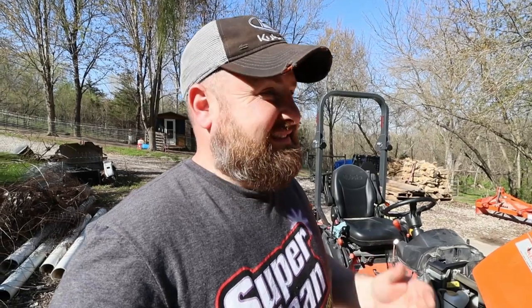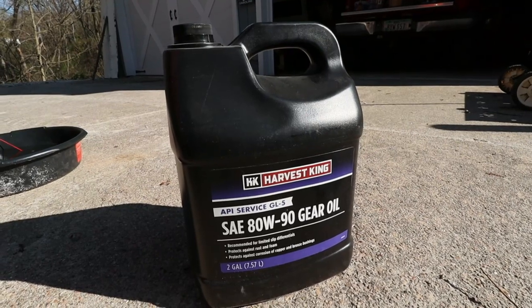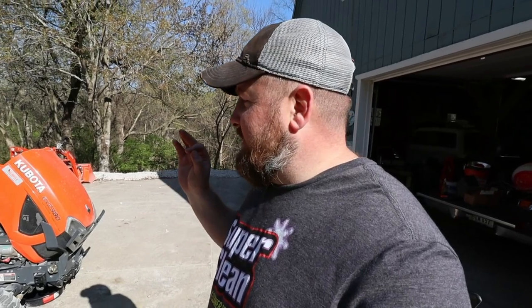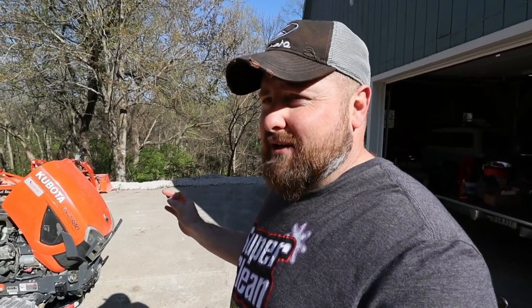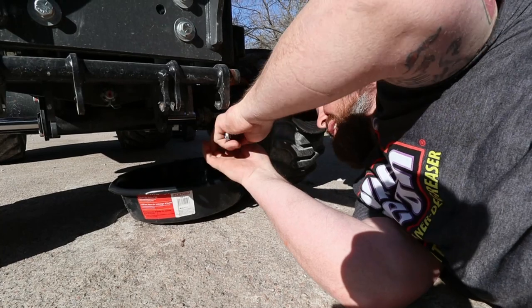There were a lot of them that said, 'Yep, there's no oil in there.' What today's video is about is draining the oil out of that front axle and showing you what it looks like. I'm praying there is no metal in that oil and it doesn't come out metallic. I'm going to put an 80-90 gear oil in there — I had used hydraulic oil, which is also recommended, but I knew I wasn't going to run that for long. I really wanted to get the fluids going and get anything that's in that axle out.